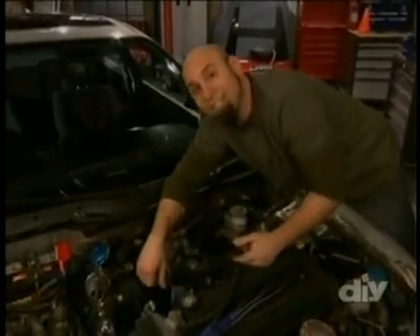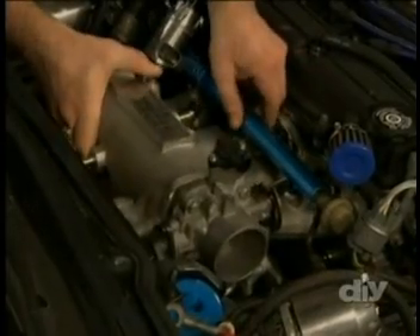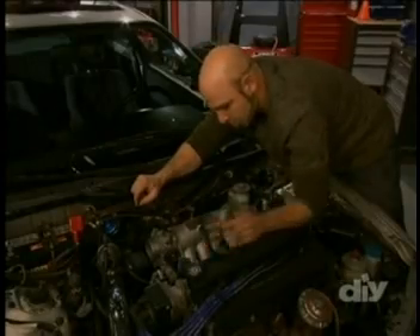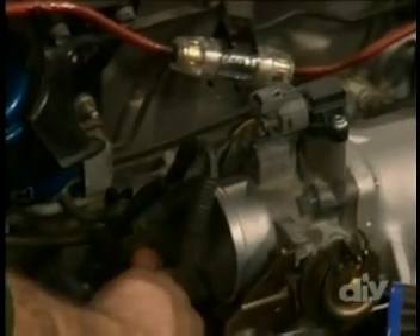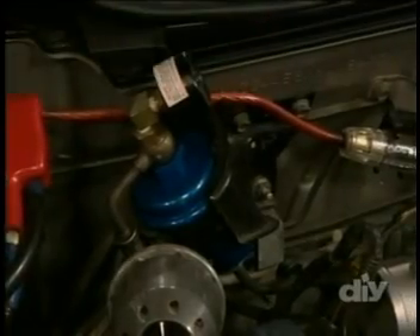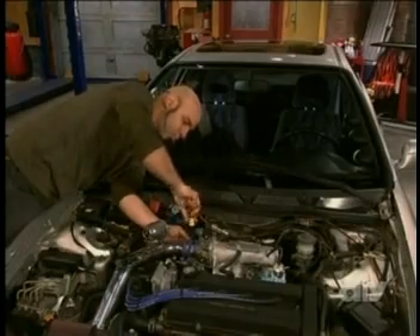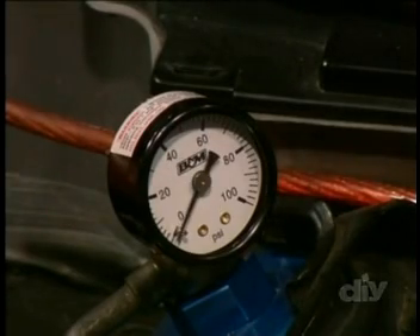Before I install the new manifold, I went ahead and scraped off the old gasket. You can use some spray gasket remover to speed the job up, but stuff some rags into the intake ports on the head so you don't get any spray in there — and remember to take the rags out before you put the new manifold on. I reattach the old canister purge valve, then place the intake manifold gasket on the studs on the side of the block, slide the new intake manifold into place, and torque down all the nuts and bolts. I replace all the hoses I removed earlier, plug in the fuel injector wiring harness, hook up the throttle and transmission kickdown cables, and plug in the map sensor and TPS plugs. The fuel line gets reconnected to the fuel filter, I reinstall the fuel gauge, replace the intake pipe coupling with a new one, refill the radiator with coolant, and reattach the negative battery cable. Before starting the car, I turn the ignition switch to run about three times to build pressure in the fuel system.